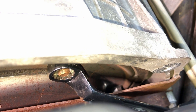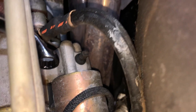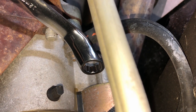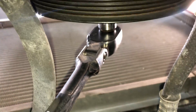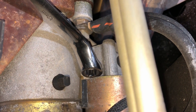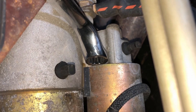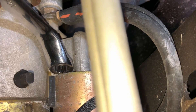What I did to make sure the crankshaft didn't move is use a double box end offset wrench on the torque converter nuts — 14 millimeter — and brought it around until it touches the starter solenoid right here. When you turn to the right as if loosening, it brings the wrench around and it sits right in that pocket, locks it perfectly. It's a straight shot over to the torque converter stud and it can't move.